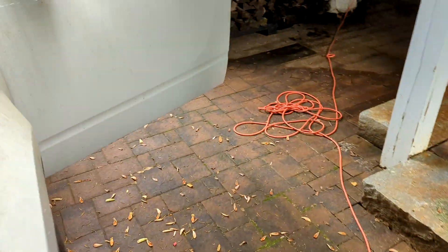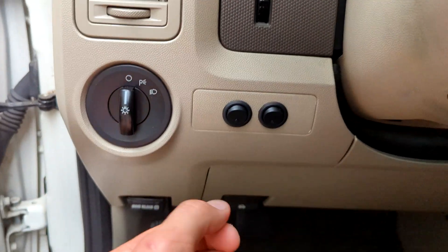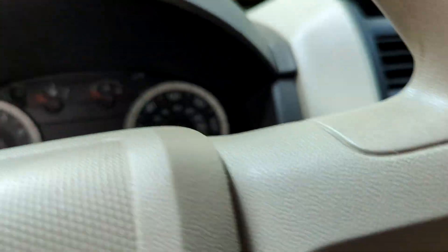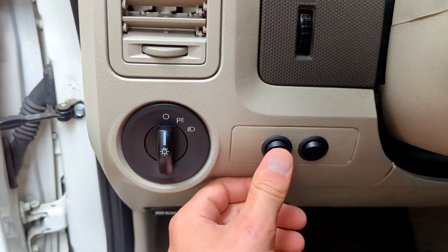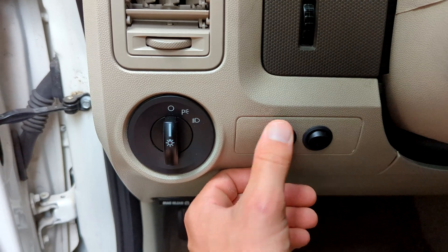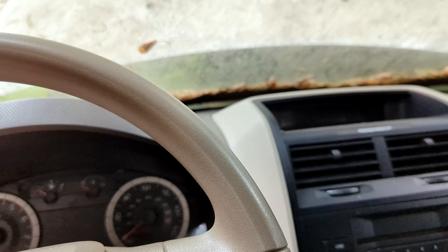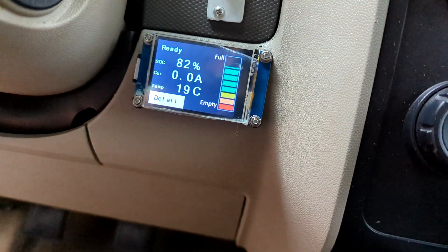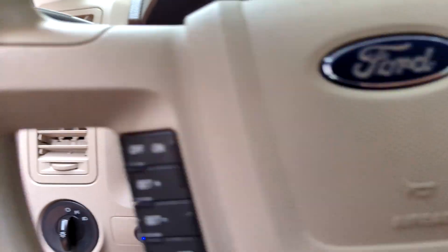If we go in the car — first do the BMS drive, switch that on, you can hear the contactor go. BMS goes into drive, and you can hear that whirring is the coolant pump. So if we shut that off and now we do the DC-DC, turn that on, you can hear the contactor switch. We wait — it takes about seven seconds for the coolant pump to start. And you don't hear it start. That's because it's now not back feeding and powering that coolant pump, which is not something I wanted it to do.